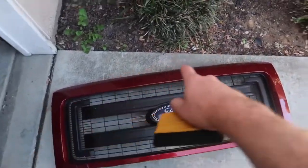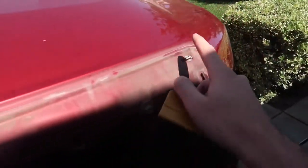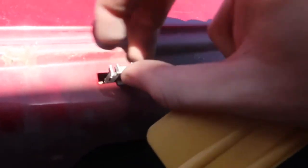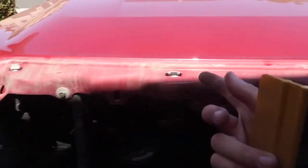To fully remove the grill, once you take out all the screws in the back, you pretty much just pull up and toward you. What I found easier is pulling it out while it's closed down. It did break some of the tabs, so you will have to replace some tabs if you put the original one back. Also, you'll need to remove any plastic pieces that broke off your original grill — I definitely broke mine, but it's not a big deal, we can always get new tabs.